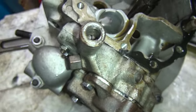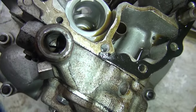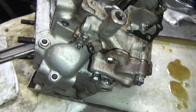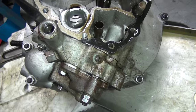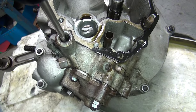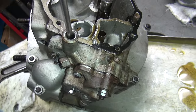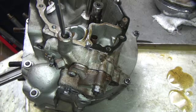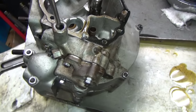It's called a pressure relief oil plug. That's not supposed to be completely bottomed out, to cut the flow of oil off to the motor? They're not supposed to be down all the way as far as they will physically go. They're only supposed to be, I think, three-eighths of an inch in, not three-quarters. So we found something else wrong that needs to be addressed. What a shocker.